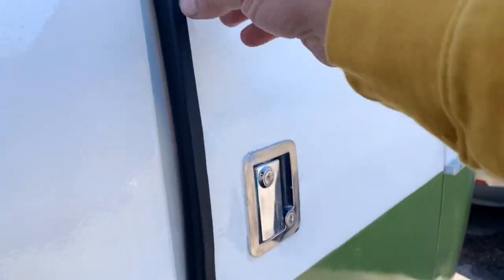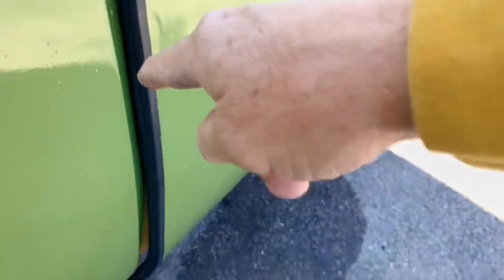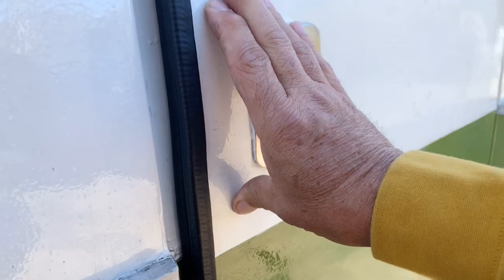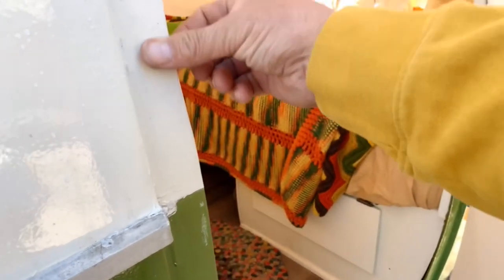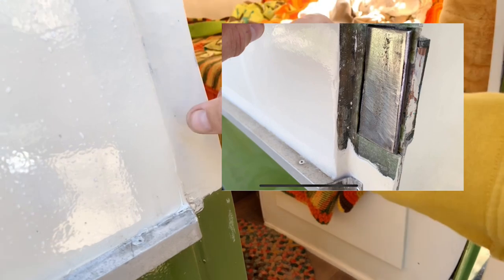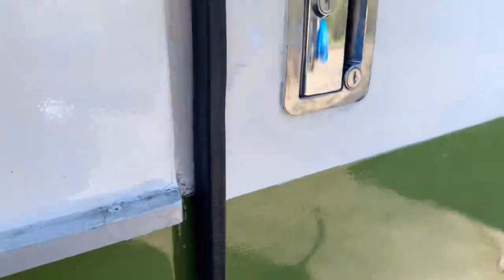Okay, see here's my door with the rubber strip — it's not on permanently, I just set it on. But look at that — see how there's like no space? That's really what I want. I need to make my door shut a little tighter, right about here. I want it to click shut because that'll be perfect. So what I'm going to have to do is take some of this paint off, grind the metal down to the bare metal — that piece of metal I put in here in my last video — and I'm going to weld a little piece of metal that just brings everything out a little bit. That might be all I need to do.